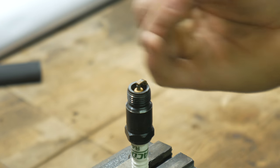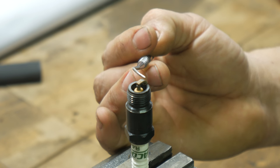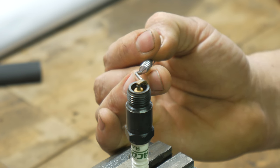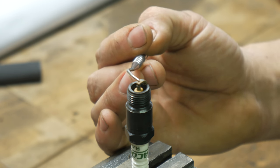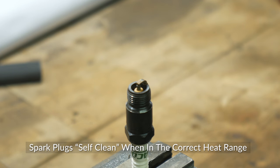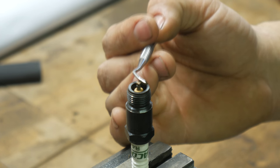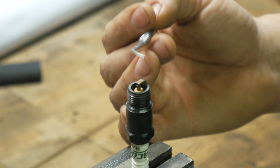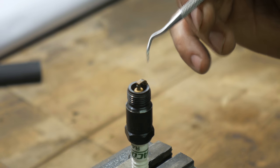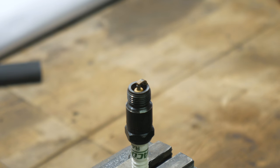On this ground strap, you can tell your heat range by it. My color change is right about where I like to see it. If the color change is too far towards the tip, it's cold - that means the heat is dissipating too quickly and will create excessive carbon buildup in your combustion chamber. If it's too hot, the color changes way down low and this can basically act like a glow plug - too hot of a plug can cause dieseling, pre-ignition, pinging - issues everybody wants to blame on timing and fuel. For me, the 44 heat range is right where I'm going to leave it.